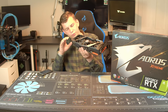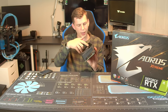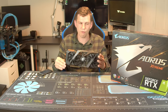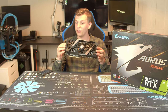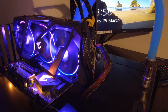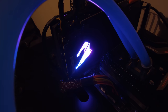It's a full heat-piped fin-array heatsink. Since this was a loaner unit I wasn't allowed to pull it apart, but we have five heat pipes running one way and a couple more pulling the other way, because the VRMs — which produce a good chunk of heat — are on that side. The core is under one side, VRMs on the other, with a 12+2 phase VRM system designed with extreme overclocking in mind, hence the name. With everything turned off it's a fairly understated-looking card despite its size. Apart from the orange NVLink cover it hasn't got anything permanent that distracts from a theme, so you could have an all-black build or use the RGBs to your preference.